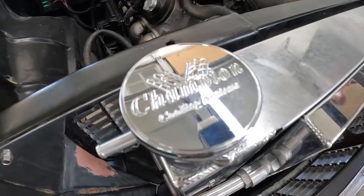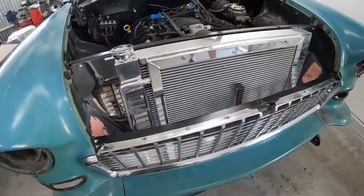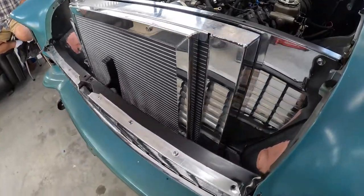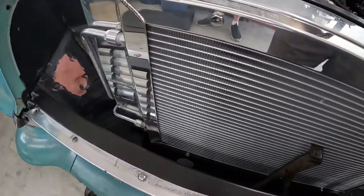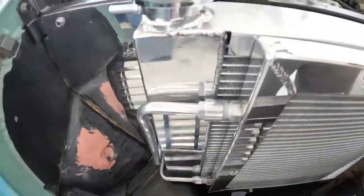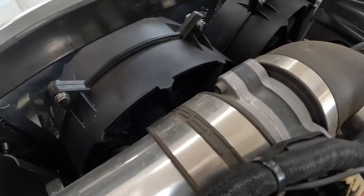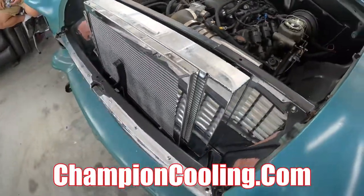There are four bolts that go through those side panels into the radiator, and then you bolt the condenser to that. I put the grill back in and the hood support back in so you can see that you don't have to modify that. With the old one, when we were trying to put in a condenser for the AC system, we would have had to grind it way down and figure out something different. Even on the engine side with dual fans, there's still plenty of room between the fans and any accessory setup.